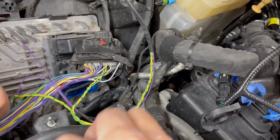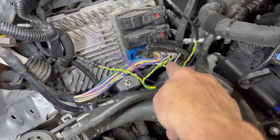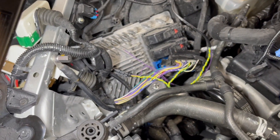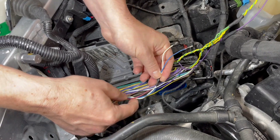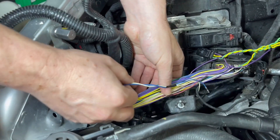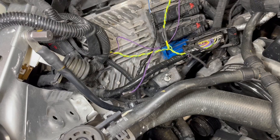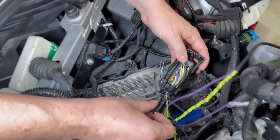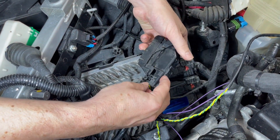So now we've had our two CAN bus wires pulled out. We're going to pull the white and blue wire out to give us some extra length to get in there. They are a twisted pair so they will be tied together — and that's the way you want to keep them, don't untwist them. That's for noise purposes in the harness. Now we have our X1 connector harness and everything all cleaned up again. JT is going to go ahead and put the cap back on that one and then we'll move on to our X2 connector.